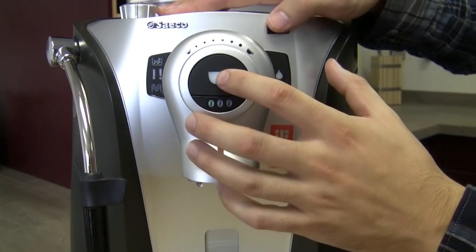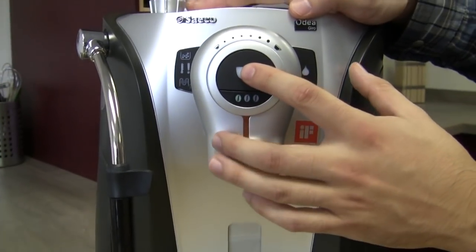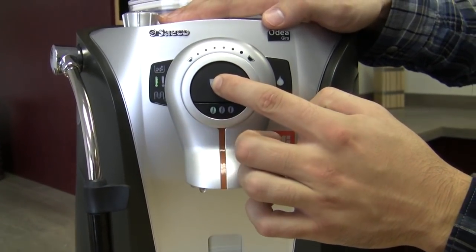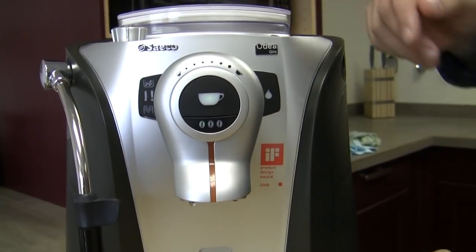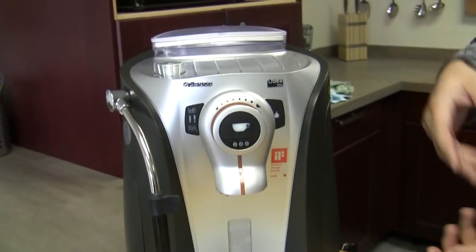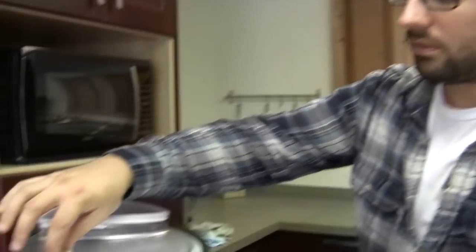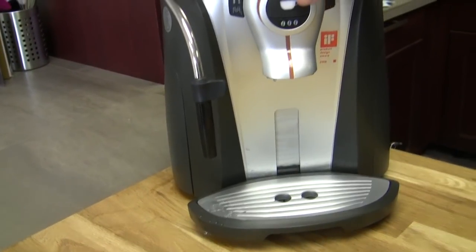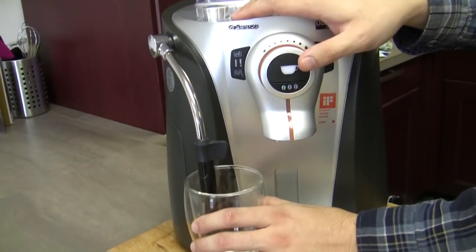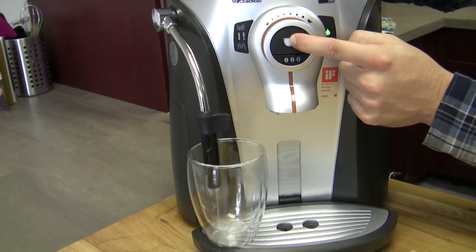Let's hit this button — this is the other button to control functionality in test mode. And that's our pump. So right now we know our pump works. Since we're in test mode it's not going to come out the dispenser because the brew unit's in home position. It's not going to come out the steam valve because I currently have it closed. So let's open it. There's a little bit of pressure that I got in there by hitting the pump while all circuits were closed. So now I'm going to hit pump again. And look at that — there you go.